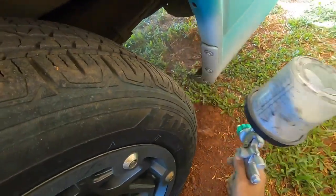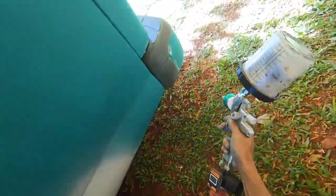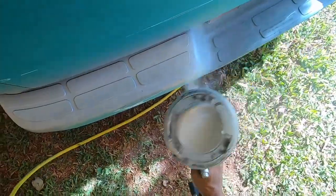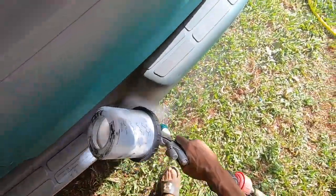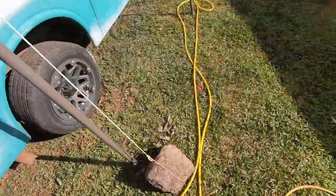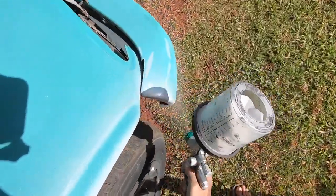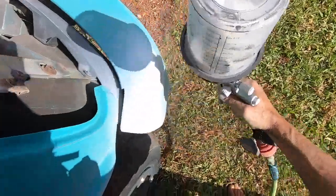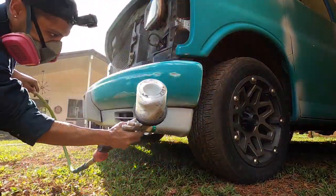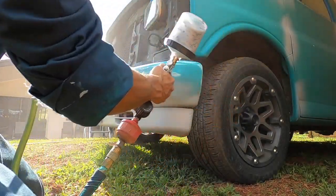The mirrors and bumpers are going to be black — plastic pieces. When priming plastic, some people ask: do I need to prime it or can I just put adhesion promoter? You could do either, or both. If you want to fill the plastic texture and get it looking like glass, fill it with a 2K filler primer, scuff it with about 320 grit — you don't want to go too rough with 80 grit or you'll cut up the plastic. Fill the plastic texture with the 2K filler primer, then sand and cut it down — we show all those steps in this video.